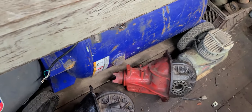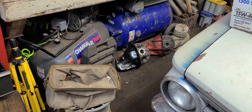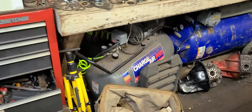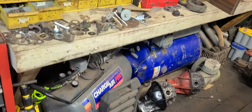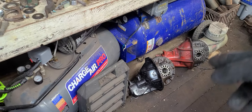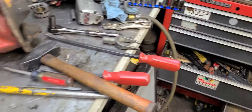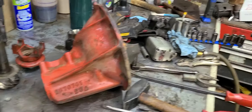Now, what if you come across one that's not a 742, not a 741, or a 489 - but it's in a Dodge truck or a big Chrysler or something like that? You look for those casting numbers. There are other casting numbers that you will find, but like I said, these are the most common ones - 741, 742, 489. Those are the ones you are going to run across the most often.